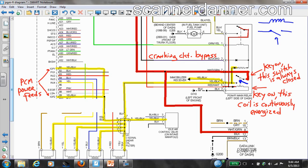What else is this connected to? Right here it goes to our data link connector — we're running a power feed down to pin 8 on the data link connector on this same circuit that feeds the PGMFI main relay. I'm not sure where you'd use that diagnostically; you'd really just check that fuse directly. So it's just a tied-in circuit, not particularly helpful in the diagram.